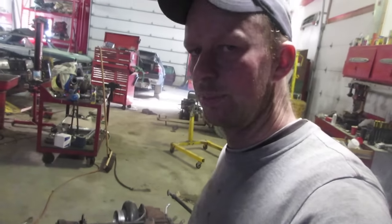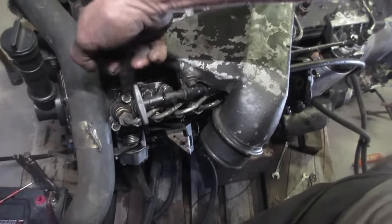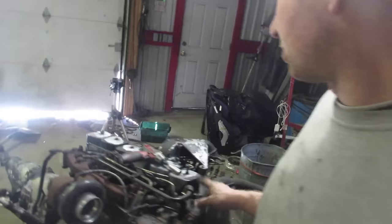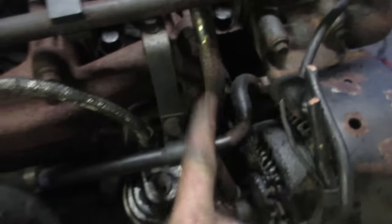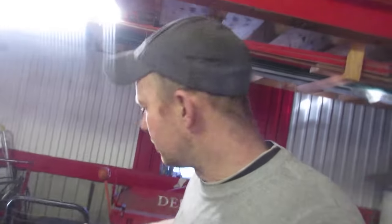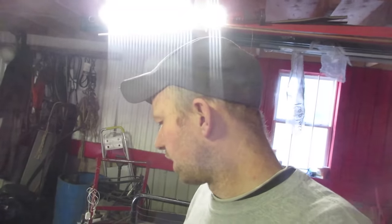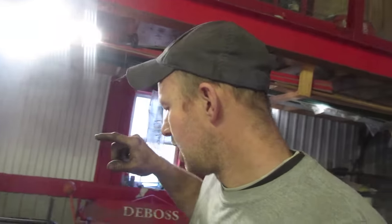That's pretty clean - a nice cheap way to look in and confirm they did some oil changes. If you're looking at an engine like this, a P-pump is worth money any day of the week. Unlike the VE pump, these pumps all have individual pumps for each cylinder. You can take these plungers out and put much bigger ones in there and really open up these engines. The 12-valves are the engine of choice for pull trucks.